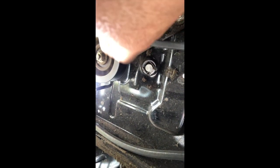If you look, this pulley is actually a double, and the higher belt up here is the one that slipped, and basically it came off this pulley, so that needs to go the other side of there, which looks really difficult. But how this vehicle engages and disengages drive is the silver pulley, you can see, moves, and when you put the foot on the brake, which is also the clutch, it moves that pulley.